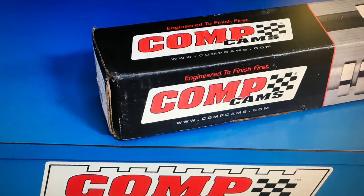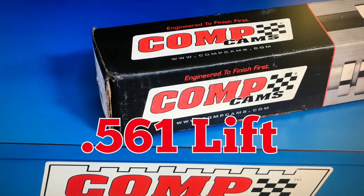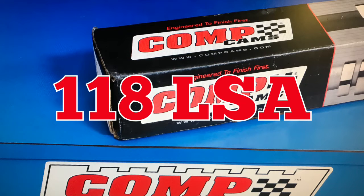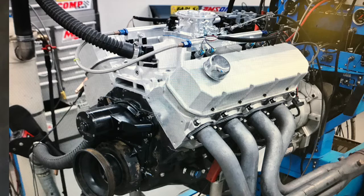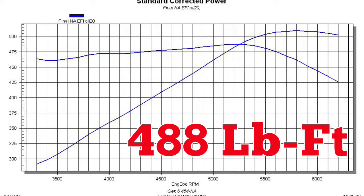But the real key was the camshaft. You see, Gen 6 454s suffer from a lack of available piston-to-valve clearance, meaning it limits the amount of camshaft you can run. This required a custom cam from the guys at Comp Cams. That cam featured 561 lift, a 233-239 degree duration split, and a wide 118 degree lobe separation angle. This cam allowed us to optimize the power output with the available piston-to-valve clearance. Equipped with that cam, as we said, the power output jumped to 512 horsepower and 488 foot-pounds of torque.